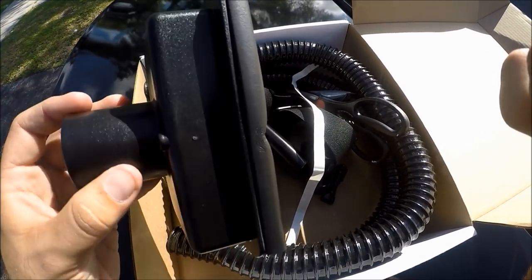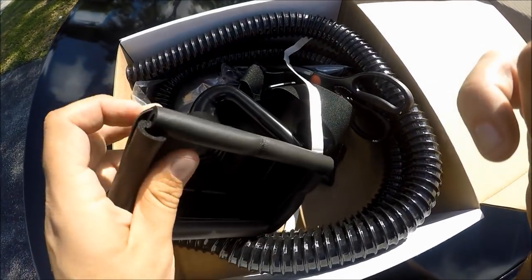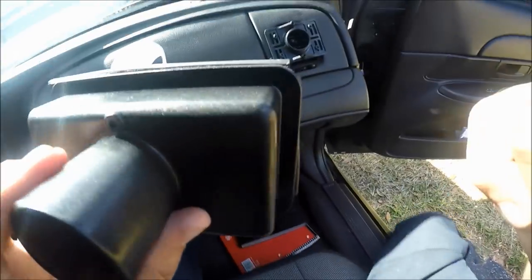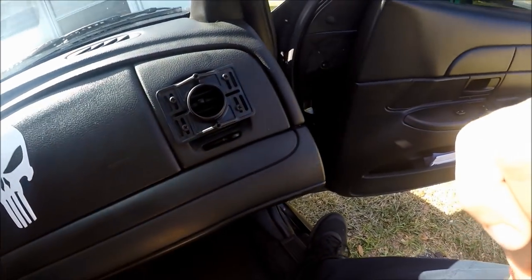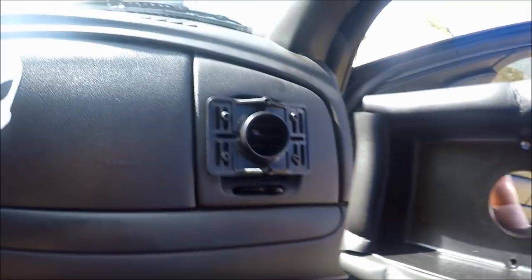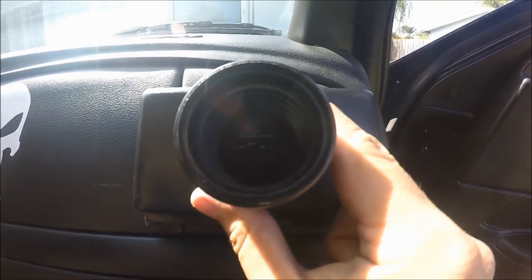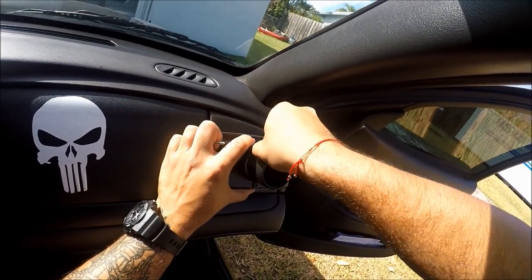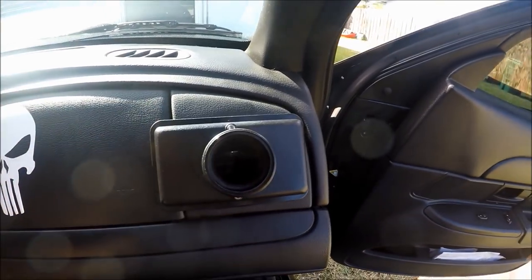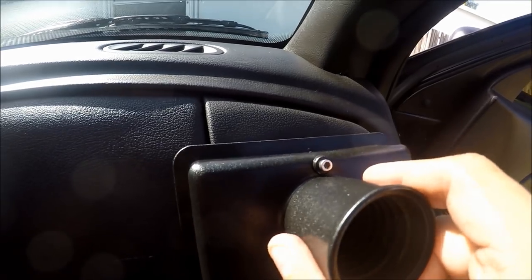What the weather strip acts as is essentially a sealant — it seals any air that might escape and makes sure nothing comes out of any little cracks, keeping everything fully pressed down. Once you've weather-sealed the box that connects to the vent bracket, this is pretty much the hardest part. These two screws here — you're going to align them with those two holes and place it right around there. And as you can see, I've properly secured the vent box to the vent bracket. It looks a little wobbly, but watch — look how snug this is. This is not going to come off.